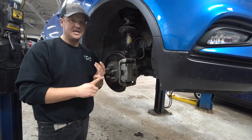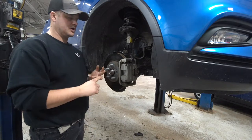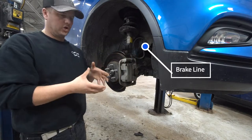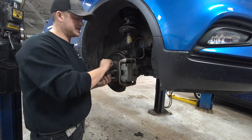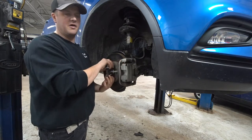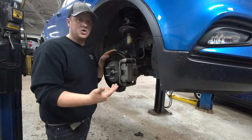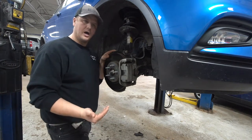The ABS brake module sees a brake signal from the pedal, so it knows you've applied the brakes. It also sees that one or more wheels have stopped turning. So it will actually let off some brake fluid pressure through an accumulator — basically a reservoir that allows a bit of that fluid pressure to release. As soon as it does, the wheel starts to turn again. It may reapply some pressure, and if the wheel locks up again it releases — doing that repeatedly. If you've experienced this in snowy conditions, you usually hear a loud ratcheting noise and feel the brake pedal moving under your foot.